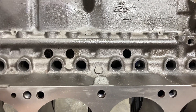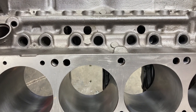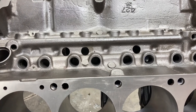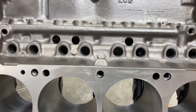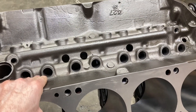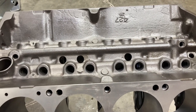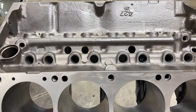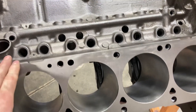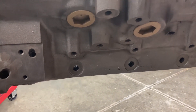In the sixties, they were fighting lots of failures due to a lack of technology — the oil pan technology really wasn't up to snuff, the oil technology wasn't there, connecting rod strength wasn't there, and lots of guys were spinning rod bearings. It wasn't really the block's fault; it was just the technology of the time for the other parts. Now we're spinning center oilers just fine — my 352 will go 7,500 RPM without any issue. A lot has changed in the past 50 or 60 years. The differences between the side oiler and the center oiler are just what I described, plus the cross-bolted main caps — that is a feature of the side oiler, and it adds a lot of strength to the bottom end.